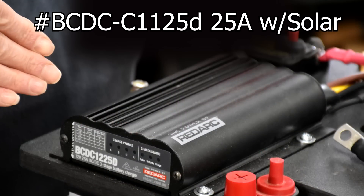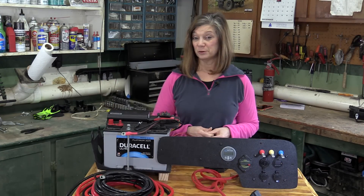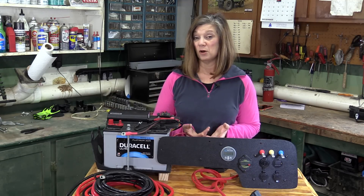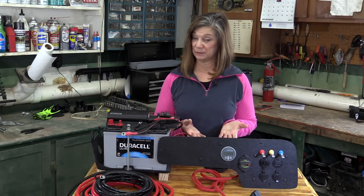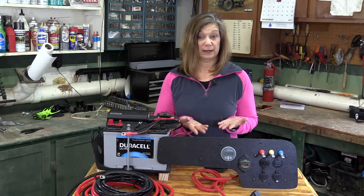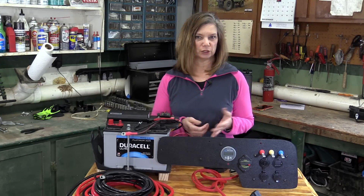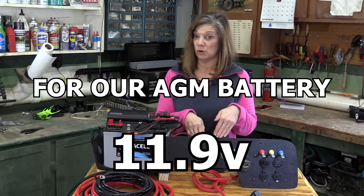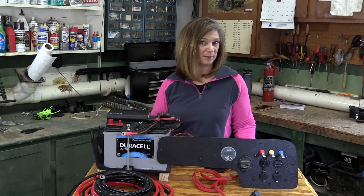This is the heart of our system — it's a RedArc DC-to-DC charger. Why a DC-to-DC charger instead of an old-fashioned relay or solenoid system? Most newer vehicles have what's called a smart alternator. Because of this, a simple battery isolator won't allow the second battery to come to a complete charge — only about 13 to 13.8 volts instead of the full 14.8 volts for an AGM battery. That might not sound like a huge difference, but in battery speak, that's huge. The good health of any battery depends on it coming up to its full charge. We'll provide a link to a more detailed video in the description below.